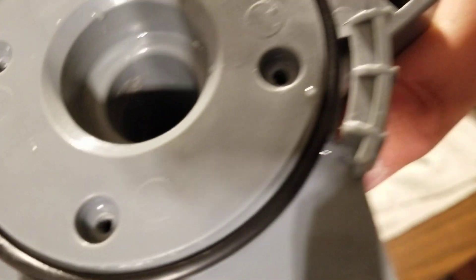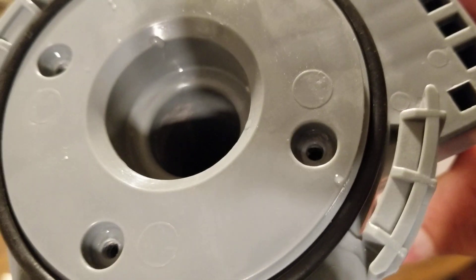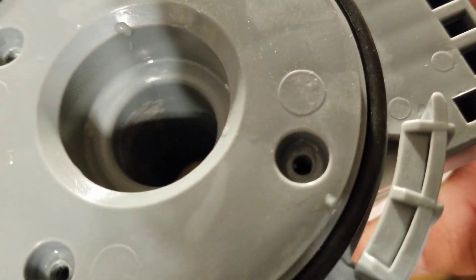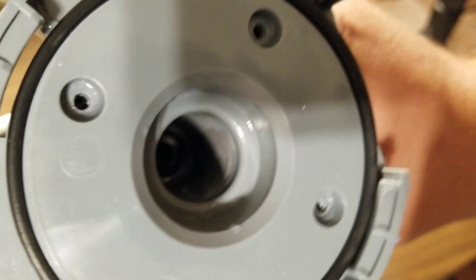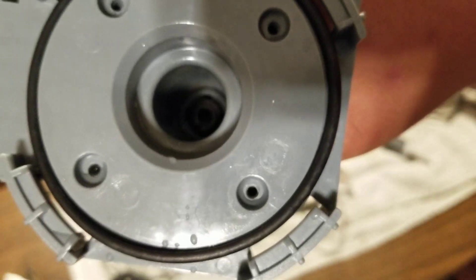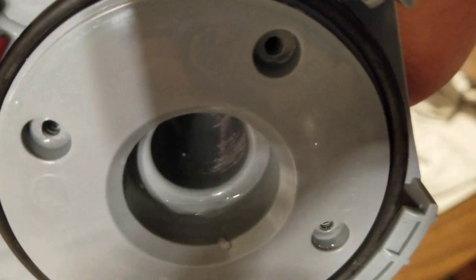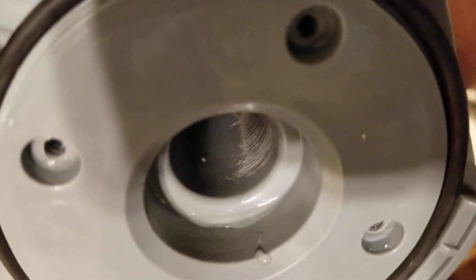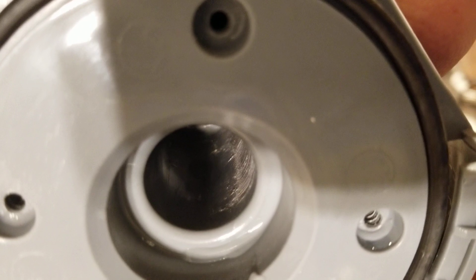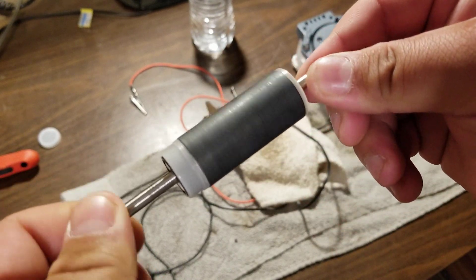If you see right here — the plastic is smooth, but then right here there is a really, really deep groove. You see those really deep scratches to the right, but right in the middle and to the left, the plastic is smooth. What's causing that is when the bearing fails and this rotor is spinning, it's causing it to sag and catch that plastic and rub against it.